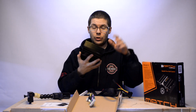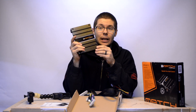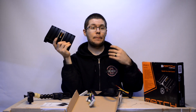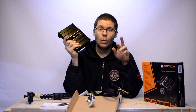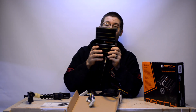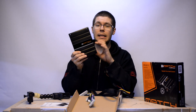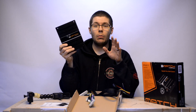It has a five-channel amplifier with a DSP built inside. You can change your crossover frequencies, low and high-pass filters, subsonic filters, and time delays. You can set your front end to a two-way fully active setup, or use passive coaxials on the front and back and mix-and-match speakers and passive components. With this, you have the ability to use DSP with your normal car setup.